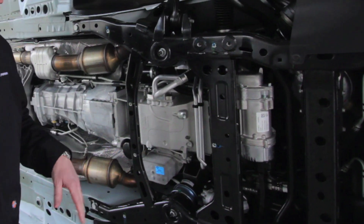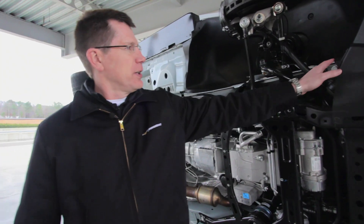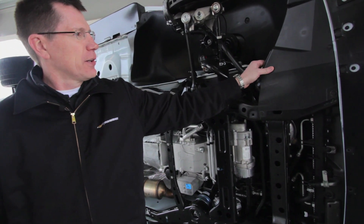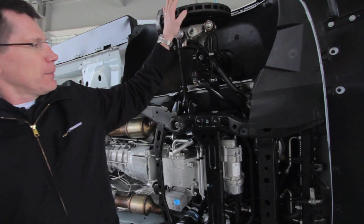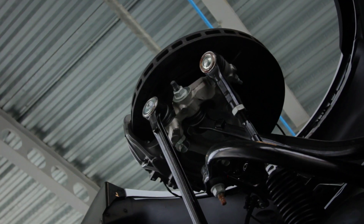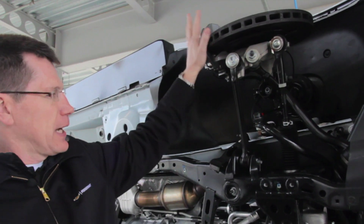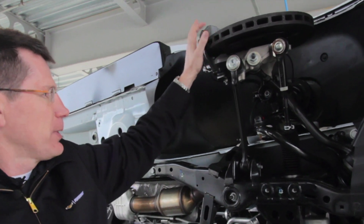With this package, the whole cooling system works a lot better. Some of the other things we did here in the front of the car: we've got very large brake cooling ducts. The carbon ceramic brakes need quite a bit of airflow because all their heat transfer is radiant heat, so you need to get the heat out of the wheel. We've got nice big Brembo carbon ceramic brakes on the car.